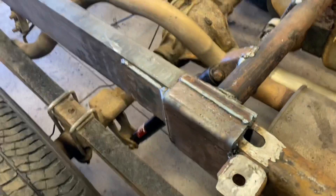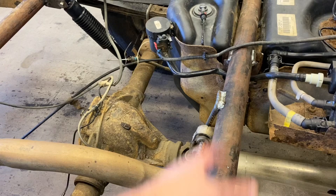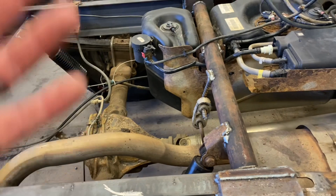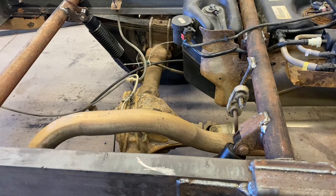This cross member from the factory has got a bend in it — any of you used to these Chevrolets knows it's got a bend. I just used a straight piece of pipe and raised it a little bit higher so that it would fit on the gas tank. It worked out perfect. I don't even know why they put a bend in them from the factory.